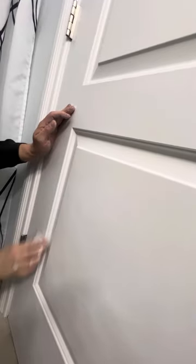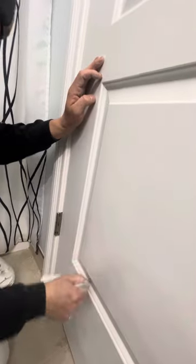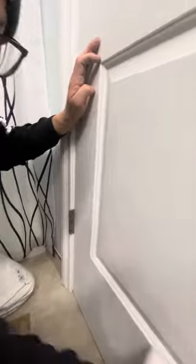Just gotta hit this guy — it's flat here — and then my piece around the box. Really paying attention if there's any scuffs like black marks or just gunk on the door, trying to hit that a little harder to get it burned out so it doesn't bleed through my paint. So that completes the sanding on this portion of the door.